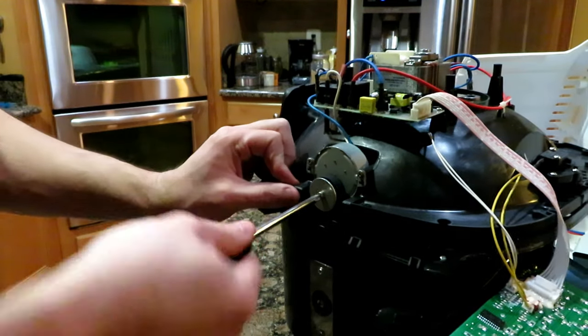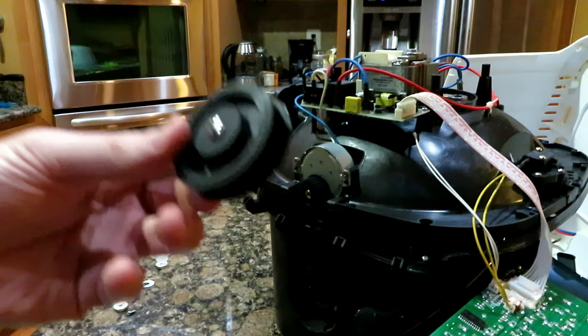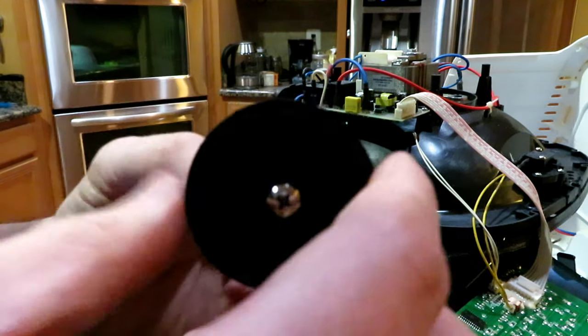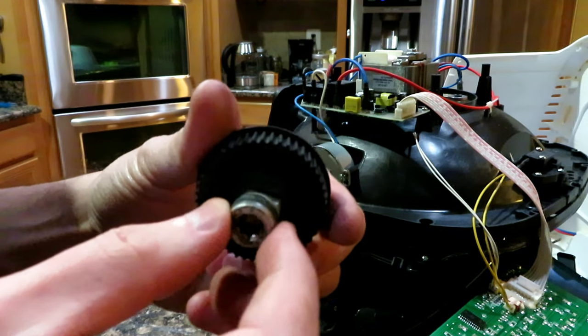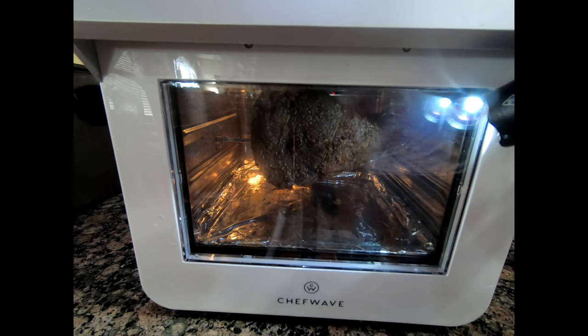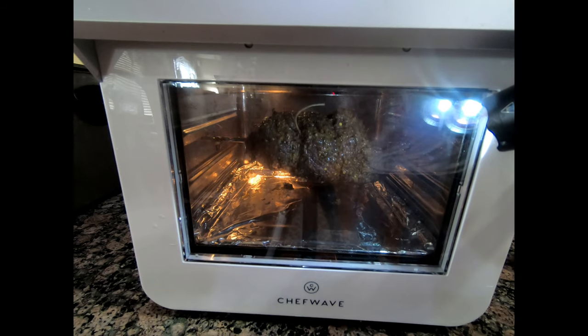This is a clip of when I took apart the power air fryer oven. This is the lower rotisserie gear pulley. As you can see there's a lot of play in this — the reason is this metal piece slips into a hole inside the pulley but the hole is too large. So if your rotisserie appliance acts this way too, this is probably why.